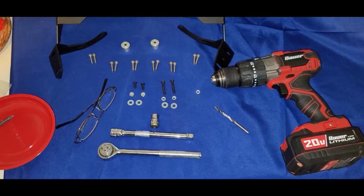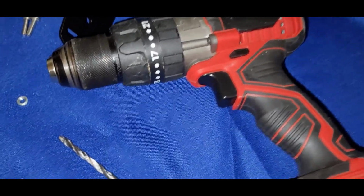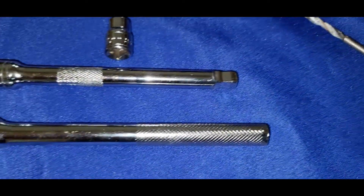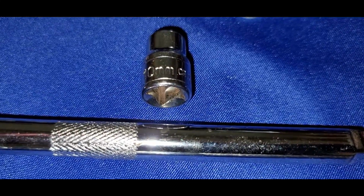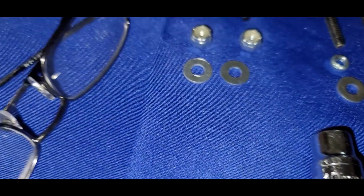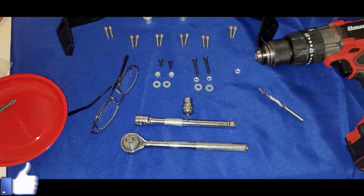very, very carefully. Because of the way the 4Runner is, at least, the radio main head unit, the plastic bezel that you're going to be cutting into or drilling into, it's all part of the same unit. So it's not a case of if you mess up, you can just order a new bezel. The way that radio head unit is designed, it's all one thing. So this is definitely a case of measure twice, drill once. I would say measure three times, drill once.